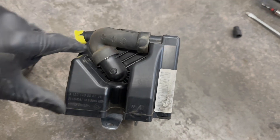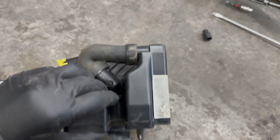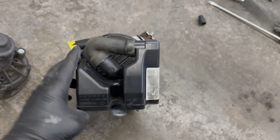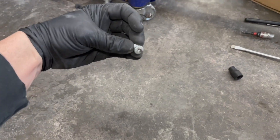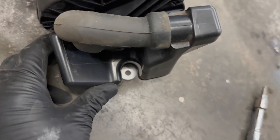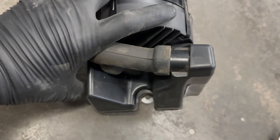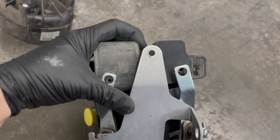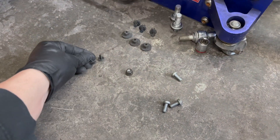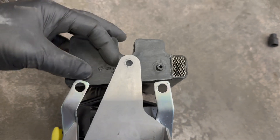This part here seems like a volume chamber with a drain for water — air gets sucked in, it doesn't allow water to accumulate, and then fresh air without any water goes through the secondary air pump. As you can see, one of these big bolts is supposed to be unscrewed from the top, and clearly you have to drop the engine to do that. This job was designed to be done with the engine either lowered in the vehicle or completely pulled out. But with our little trick — removing the two smaller screws from the bottom, pushing the bracket one way to remove one, pushing it the other way to remove the other — that gave us access to the hidden screw.